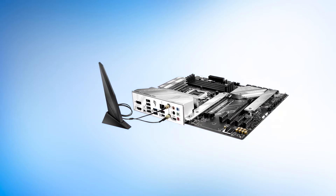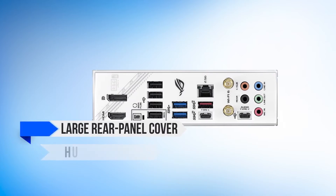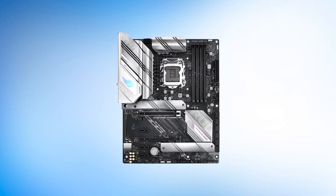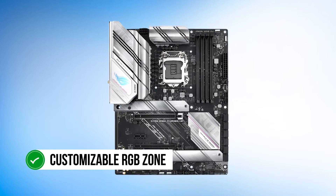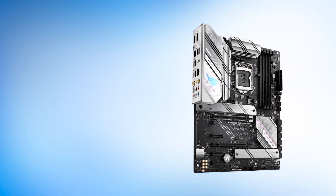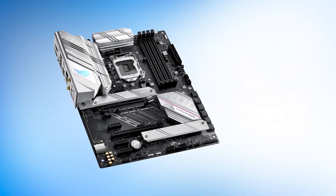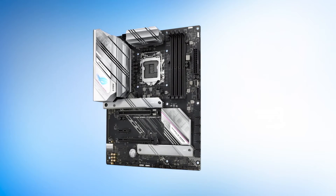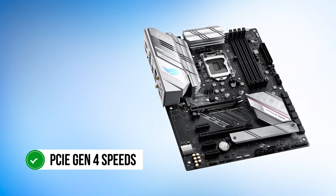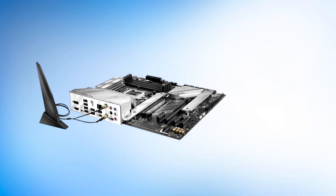Many people already know what to expect with this motherboard. The design is simply very impressive — it features a familiarly large rear panel cover, huge VRM heatsinks, and a big chipset heatsink. Both the rear panel cover and chipset heatsink feature ROG branding, and the rear panel cover also has a customizable RGB zone. For the price, this is a very elegant looking motherboard and might just be one of the best white motherboards on the B560 platform. B560 comes with its limitations — memory overclocking and overclocking in general is not the best. Even so, this motherboard punches above its weight. You get two PCIe full-length slots and dual M.2 slots, one of which can take advantage of PCIe Gen 4 speeds. You also get access to the intuitive BIOS and AuraSync from Asus, and connectivity features are great here as well.